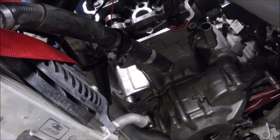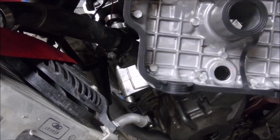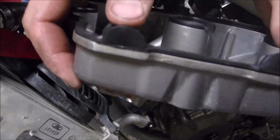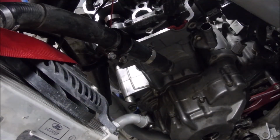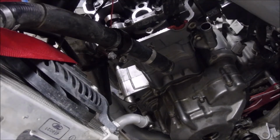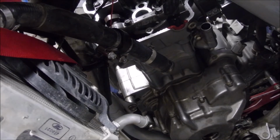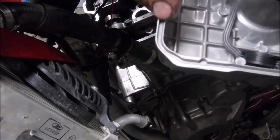Now we're going to take the cylinder head cover, which I've thrown a new gasket in here. It only goes one way. These are the little pieces that need the silicone to help seal. So I'm going to make sure that's all in place. Here's the tricky part, sneaking it past. Oh, there it goes. This is the problem, is that it falls out, and you do need it in the cover side because of this little tray first.